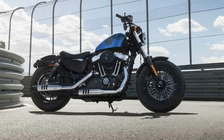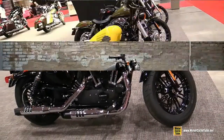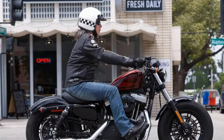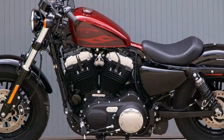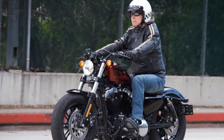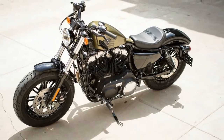It starts with a cut-down or bob-front fender that rides between blacked-out fork sliders over a similarly achromatic cast wheel. The dark treatment continues into the triple-tree, turn signals, headlight, and tall boy bars that raise your fist 7.25 inches with an outlaw custom flare. Though it carries lots of black paint, it has a lot more in the way of chrome on display than did the base 48 — namely the engine cases, primary cover, and sprocket cover, with various bits and bulbs scattered about.